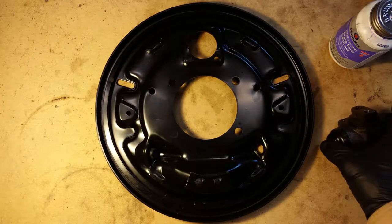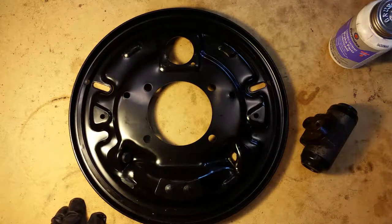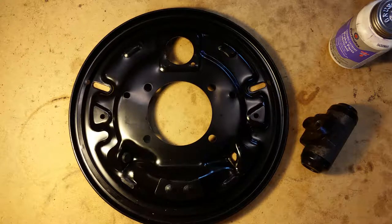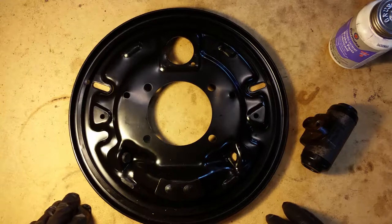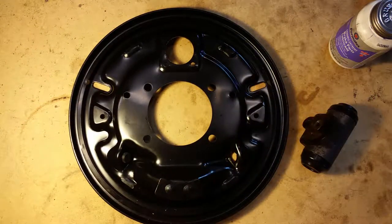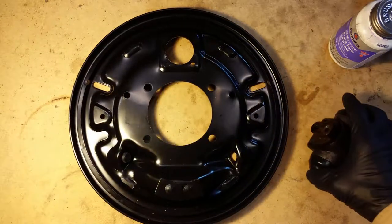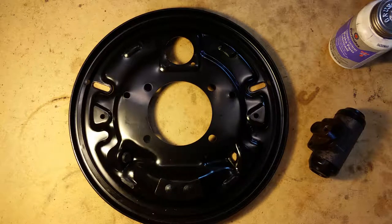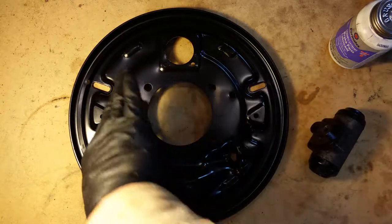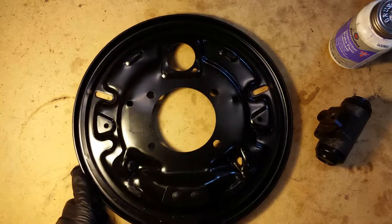These are the non-obvious parts because everyone thinks of the spring setup being wrong, shoes installed incorrectly, or shoes being backwards. Some cars require you to put the small shoe towards the front of the vehicle and the rear shoe towards the back. On this particular truck — my 1990 K1500 — they're identical, both front and rear, so it doesn't matter which way you put them. But your vehicle may be different, so make sure you check the service manual on that.